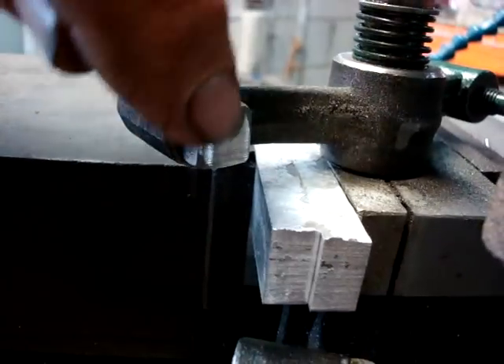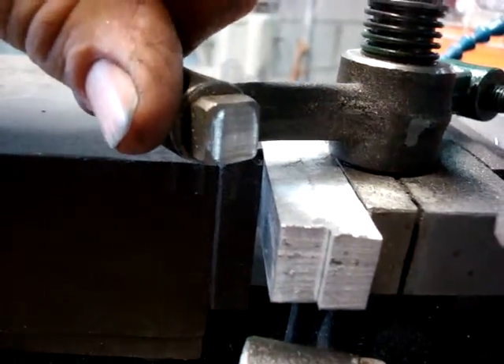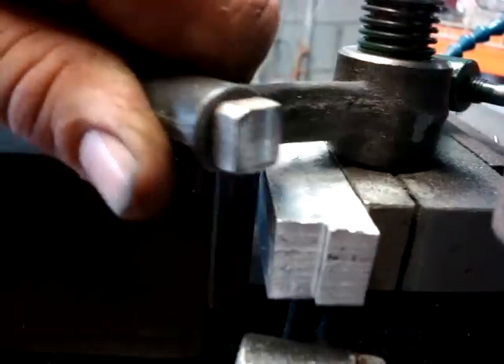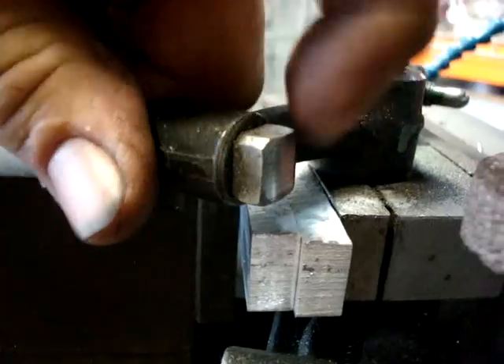The curvature remains so that as it pushes down on the valve, the valve actually rides back and forth across the surface — that's why it's got to be curved. It doesn't just contact and push. As it pushes down during that motion, this valve stem is actually riding back and forth a little bit across this face, so you need the curvature.